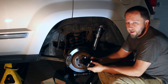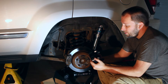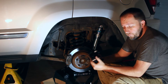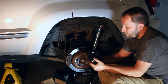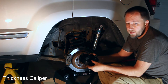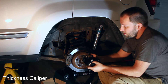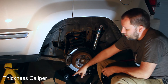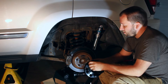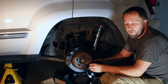The other thing is bad manufacturing — make sure you go with a quality spacer. I went through it with a caliper when I first got this and made sure it's completely smooth everywhere. You also want to make sure your studs are in good shape, both on the hub and on the spacer. I'm going with brand new lug nuts as well since these are new studs. So we'll get on to the install and I'll show you the proper way to do this.